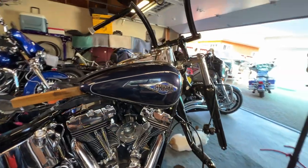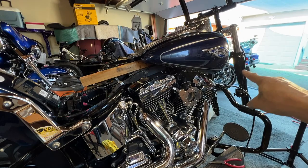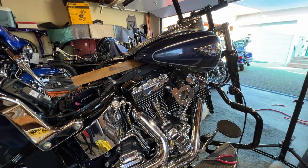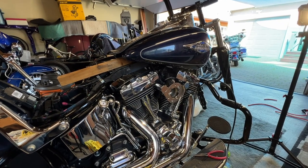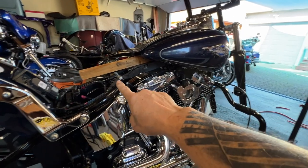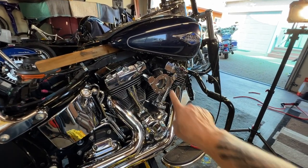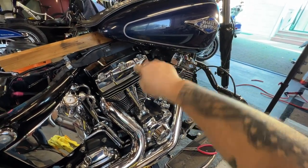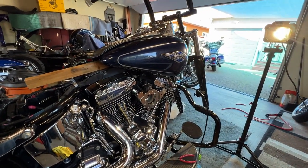Let me show you what I did back here. All I did was lift up the back of the tank because it has that fuel line that goes from one side of the tank to the other. Unless you crimp that, you can't lift the gas tank off of the frame. I didn't really need to lift it off the frame - I took about a gallon and a half of gas out of it to make it lighter. All you do is put a one-by or two-by board to actually lift that up, and it gives you enough room to be able to see. When I feed the new cables through, I have enough room to feed them through without the tank in my way.